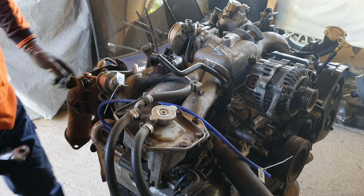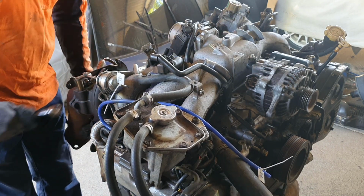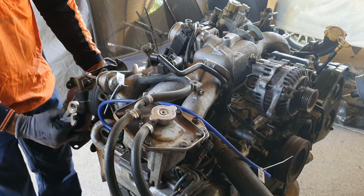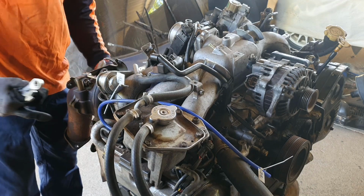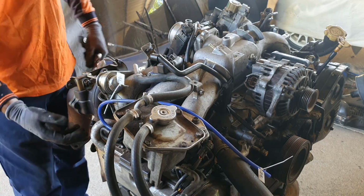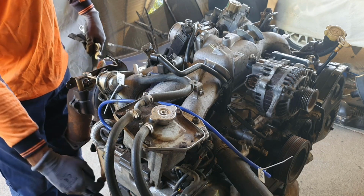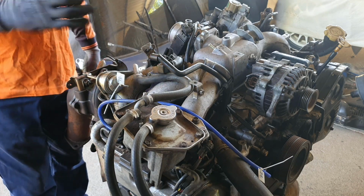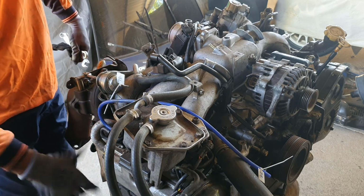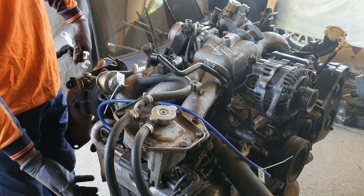The most important part with these is to make sure that the bracing to the engine for the top of the up pipe is all in and all the brackets are bolted in tight, which I've checked, and they're all good on this. That's great, because it's quite common also for the up pipe to crack. It's like a crinkle cut chip in there, like an oven baked crinkle cut chip. It wasn't the best design. They didn't use a flex joint.